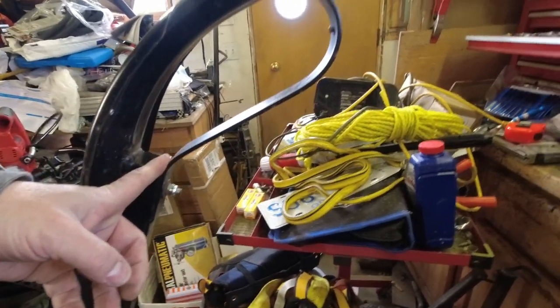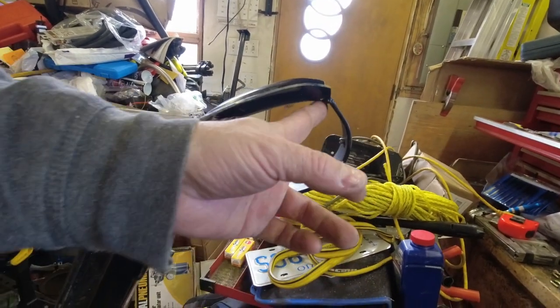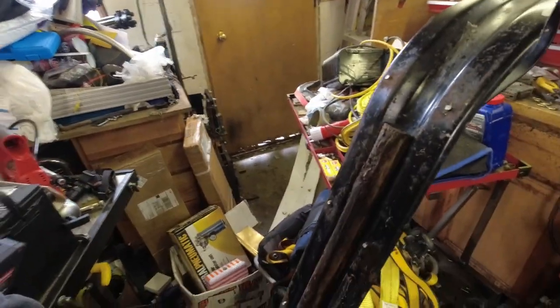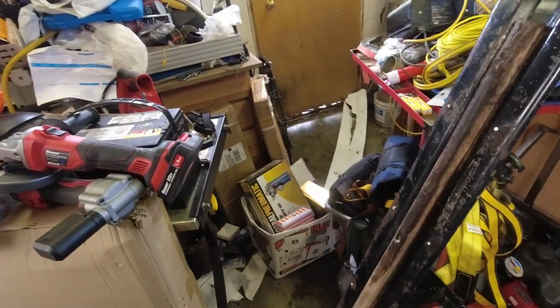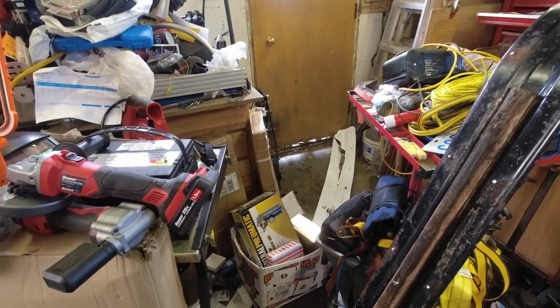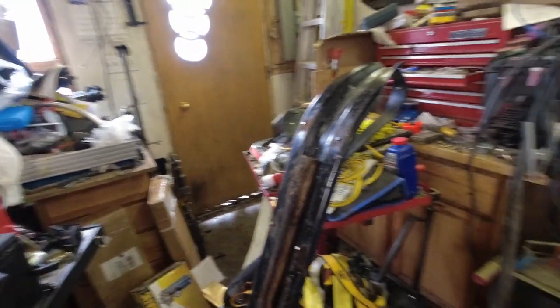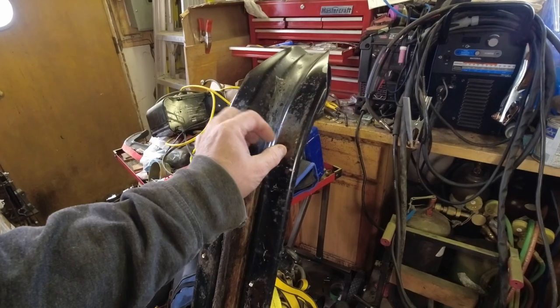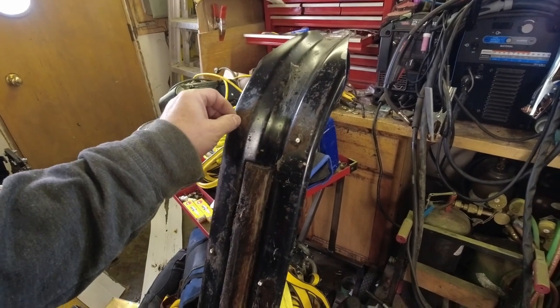And then this is inch-and-a-half-wide strap that I've welded on that provides a ski loop that can be grabbed onto or hooked onto with a strap if we need to tow this thing out of a hole. Generally this thing tows through slush not too bad. And then as you can see the skins that I had riveted on with 3/16 steel large-head pop rivets.